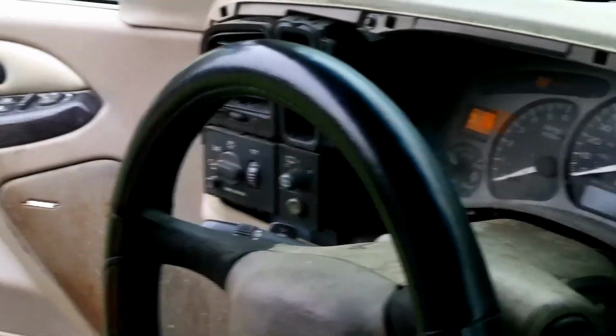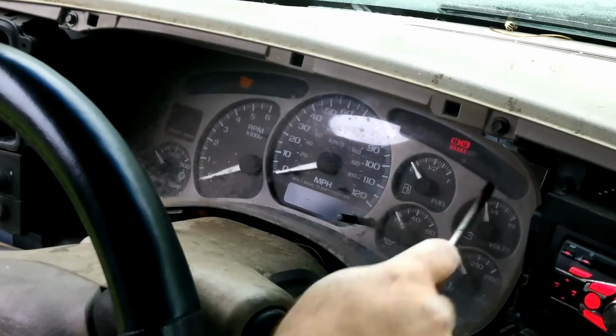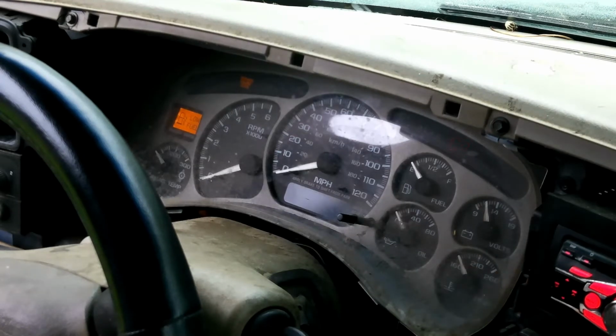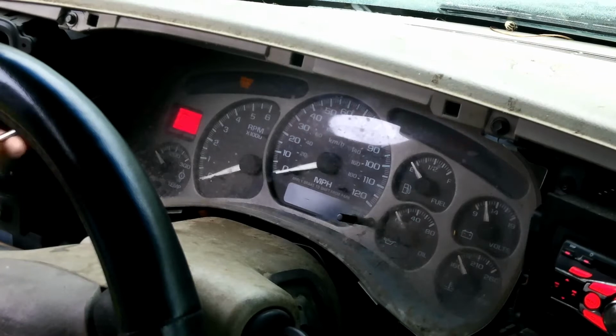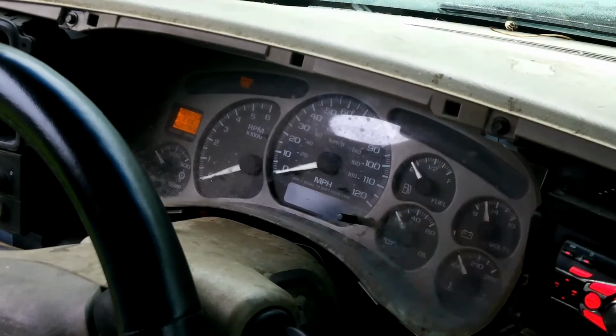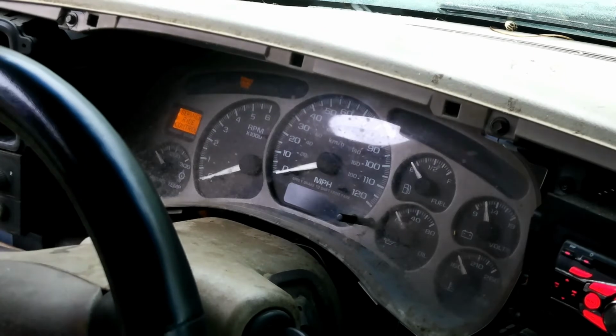And that's going to reveal the instrument panel, and it's really simple. We've got a 10mm bolt there, a 10mm bolt down there, and then there and there. So just 4 of them, although they look a little bit smaller than 10mm, and they are. They might actually be 8mm, so give me a second to grab the right socket.